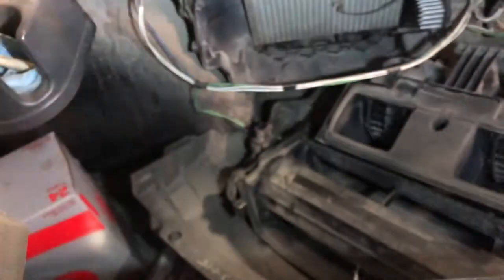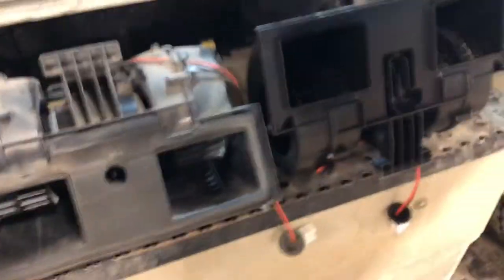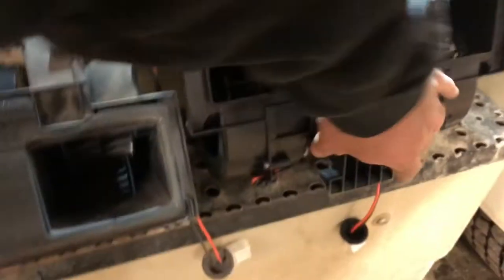You want to make sure to clean this filter as often as necessary. If you're working on gravel you should probably do it at least once a month, or at least when you change the oil. It's kind of difficult to get to on this truck — you kind of have to take half the dash apart to get to it. I wish the engineers that built these trucks took serviceability into account when designing this kind of stuff. Next I just compared the old blower motor to the new one to make sure I had the right one.